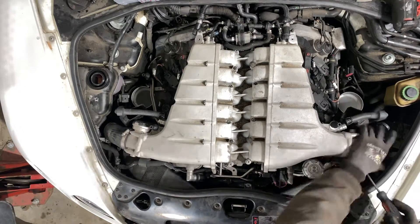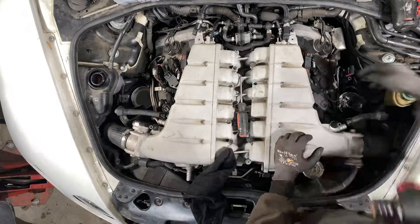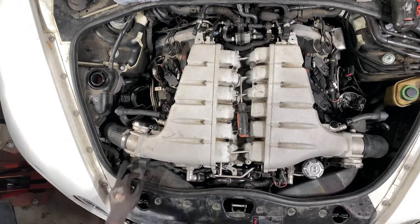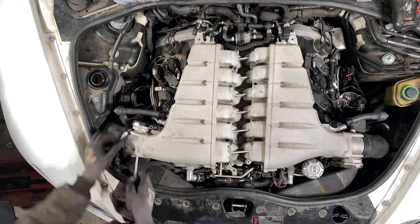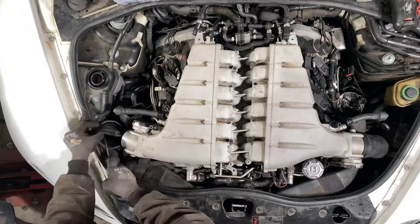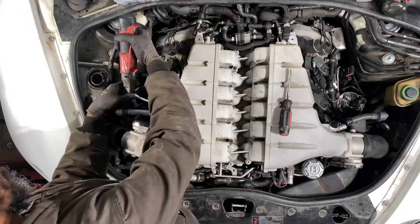This is a charge air hose, but first before I get any further, I grab some cloth and stuff it down into the intake ports going to the turbocharger — we don't want to lose anything down there and get unhappy surprises.